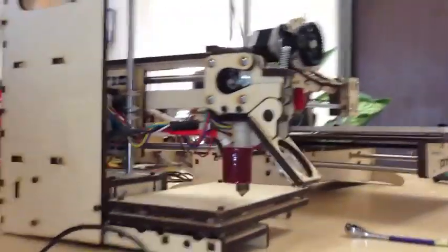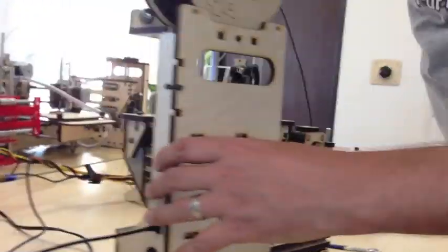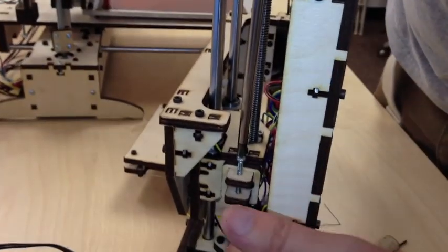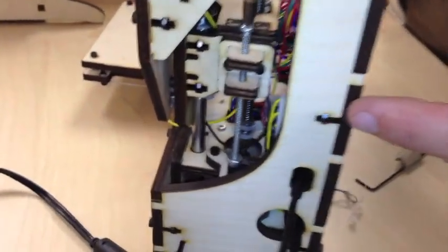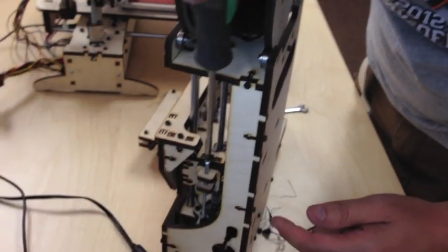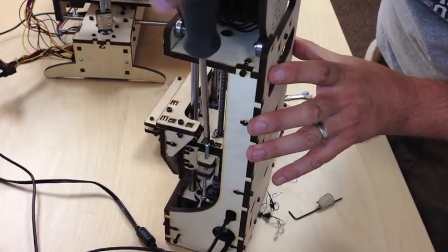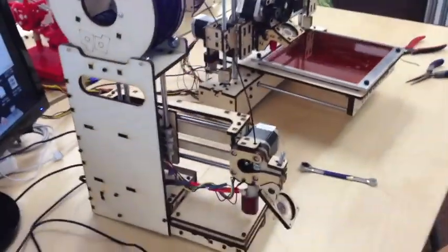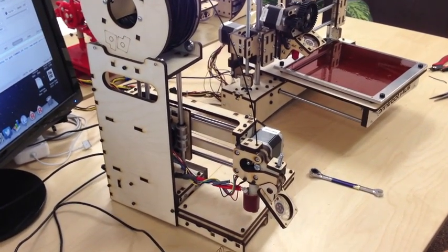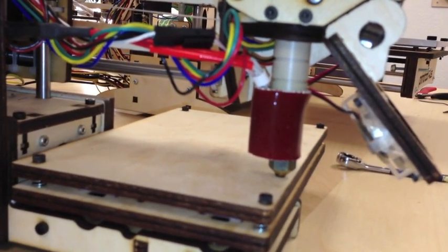I'm going to take a screwdriver. On the Simple I have to go to the back of the printer and adjust this screw, because this screw is engaging the end stop switch. I'm going to turn counter-clockwise — lefty loosen — so that the hot end can go down further before it engages the end stop. I'll ballpark that. Since I'm already homed on X and Y, I'll just home Z at this point. It looks like I got it right there — I guessed properly. If I home the Z-axis again it'll lift up and drop right there. Pretty good.